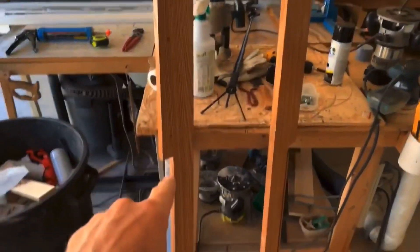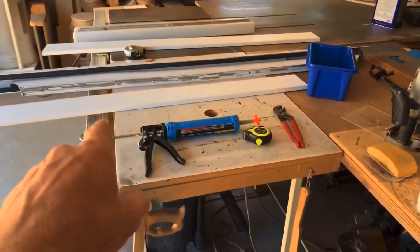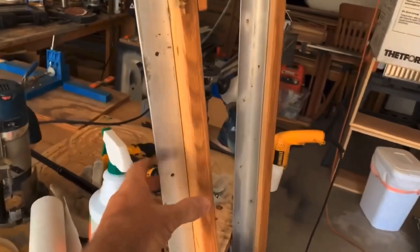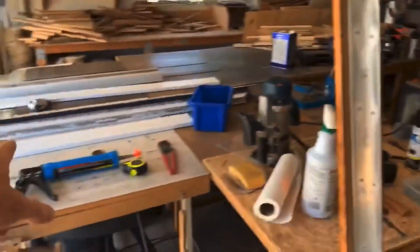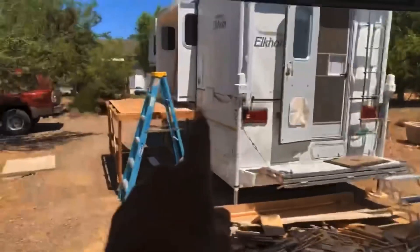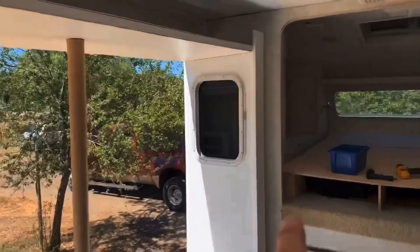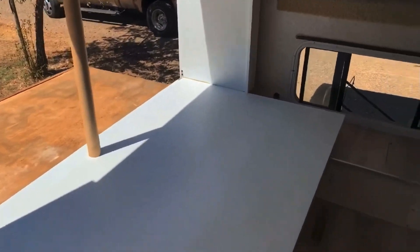These were the old T-molding pieces for the inside — that faux wood trim — and I'm doing composite. I've already cut them to length and to width. Now I just need to measure where the angle aluminum goes and get them mounted with screws and adhesive to the back side of the new trim pieces, then get them in on the inside of the new slide out. I've got both of my T-molding bolsters cut for the sides and that'll allow me to get this thing squared up and bolted down to the slide out mechanism.